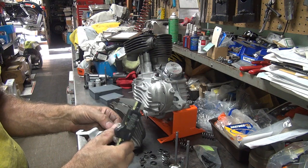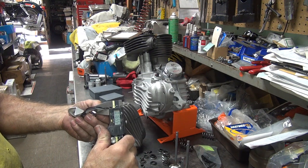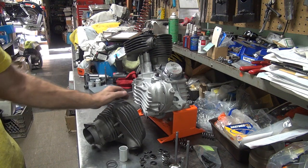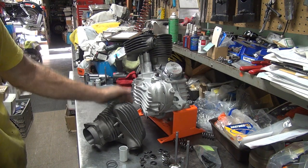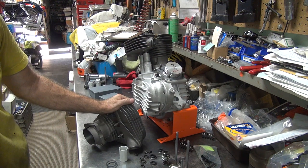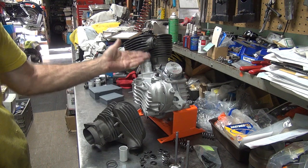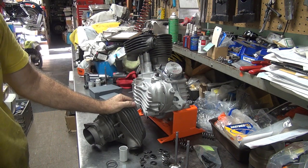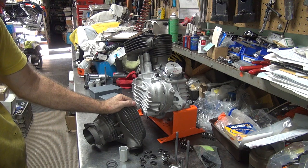I only went up by 10. It's 165 thou of crap in here. So you figure it's 150 here. And if we had a quarter inch before, then that puts it at 100. Yeah, that's 100. So if you figure 125, that gives an extra 25. We shouldn't bottom out. So I think we're looking at about an eighth inch thick washer is what we need.